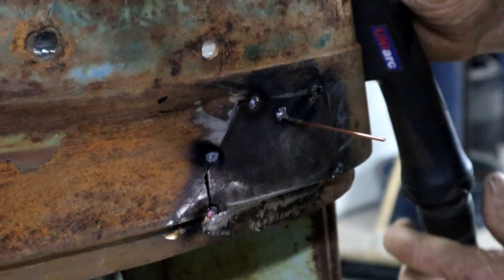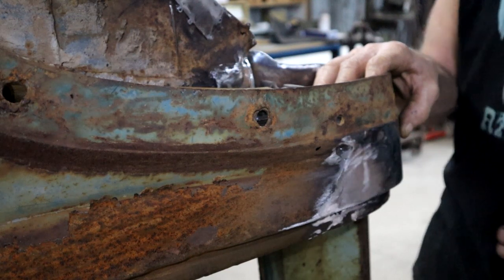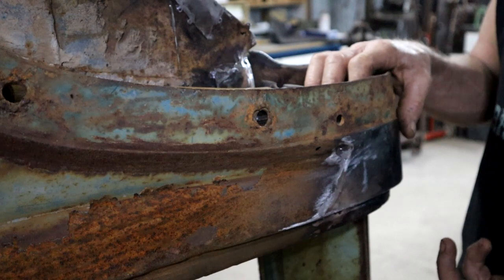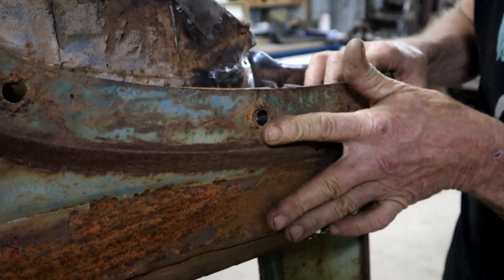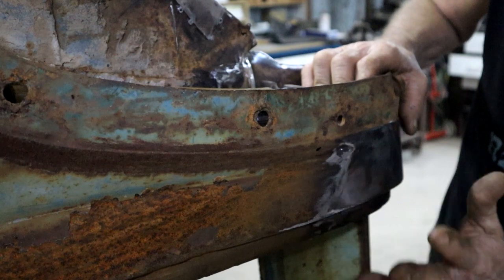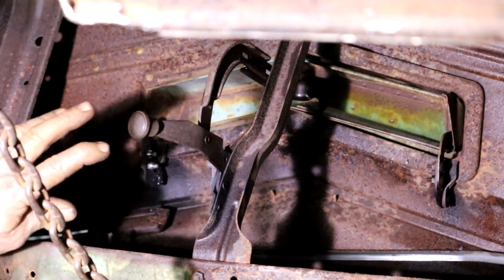Now I must just weld it up slowly. I do believe it's a successful skin graft. It's important to keep in mind that we've been using the firm skin of a 16 year old and attached it to a 70 year old lady. So unless you replace all the skin, there will always be some wrinkles. For me, the wrinkles like this one here - we want that. It shows the character. So I've blended this in into that wrinkle. And by the time it's rusted up, I don't think you'll even know that this was ever grafted in place. With the cab still lying on its back, access to this area below the dash was easy.